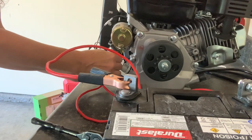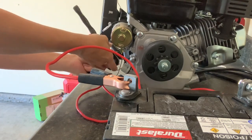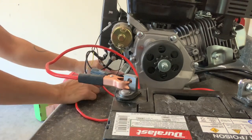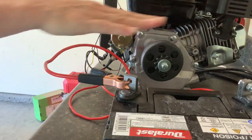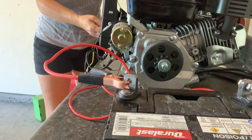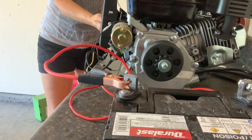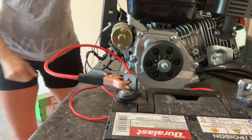Those two wires hooked to the solenoid, ground hooked up, battery hooked up — and it should turn over. Put the key in, on, start. And that's all there is to it. So remember, the yellow wire doesn't go to anything. You all have a wonderful day, thanks for watching, take care, and good luck with all of your projects.